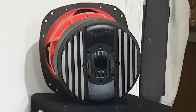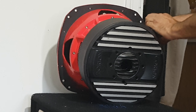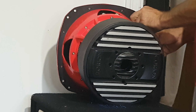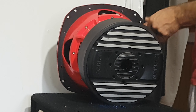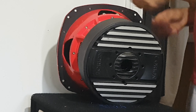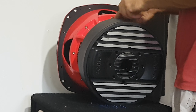This is a dual two ohm. I was trying to look into it to see if they make a dual one, but unfortunately they don't. If it is going to cost me that much for an HCCA, I can use this motor with flat wires and better coils. The only thing I don't like about this speaker is that it is an 8 gauge input but you can't put any connectors into it — you have to go straight into the inputs. I'm not happy with that because I did buy a dual 8 gauge to 4 gauge wire adapter considering how much power this thing takes.